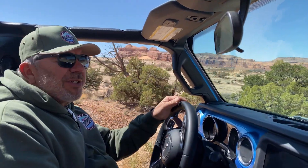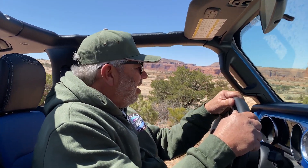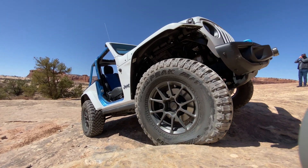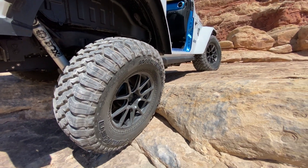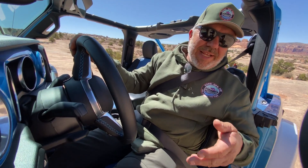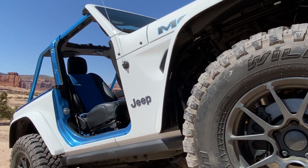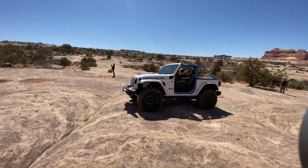Excuse me — volt it? What's the proper term? Electro it? I'm going to go really slow here, I just want to creepy crawl it. I'm barely on the throttle — which, is it a throttle anymore? It's not a gas pedal. It takes a little bit of getting used to. This doesn't have one of those hill hold buttons, and being that it's an electric motor and you're supposed to be going forward in this mode, it will actually roll back on you. See how we're going back? Very slow, mind you. So that's something to think about. But remember, this is a prototype — they're figuring out exactly how to make it perfect. You can get pulled really quickly in first gear.